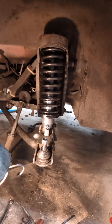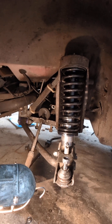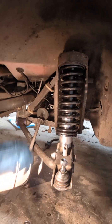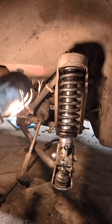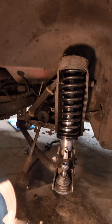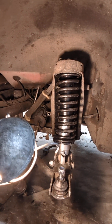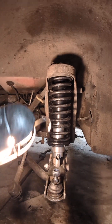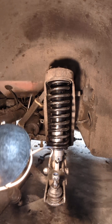Here's what we've got going on today: got the lower control arm in with a new bushing — finally, that's a big pain to get in there. Got some Pro-Tech shocks from SJ Sports Car in England. They seem like really nice quality — stock spring rates, but at least it's adjustable height with an adjustable damper. These are about an inch and a half to two inches shorter than stock, so it should look good when it's down. Not a lot of camber adjustment stock, so it'll be running a little camber up front just because of the drop.